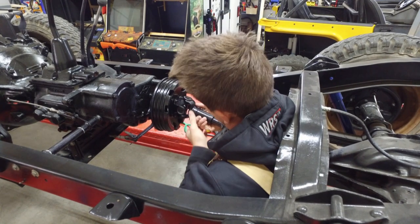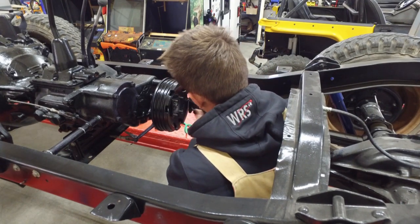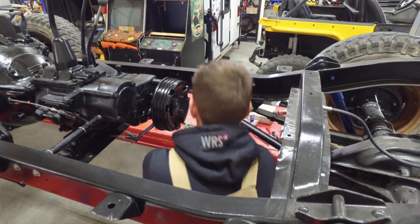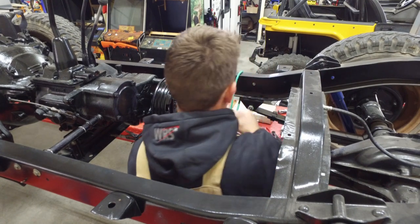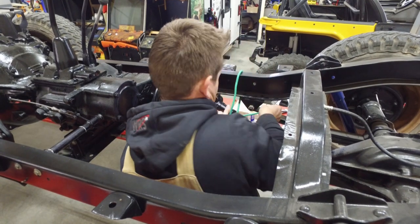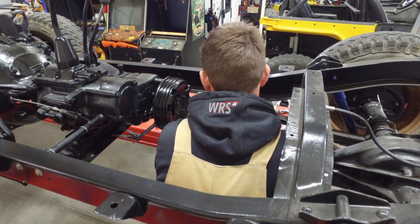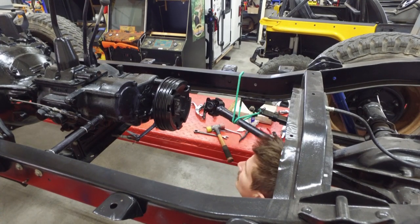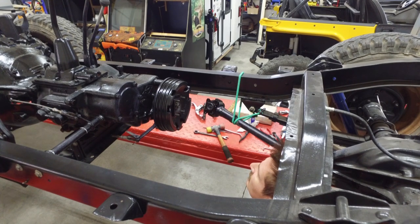And then get ready, when you squeeze this back, a bunch of grease is gonna shoot out. And then what you can do, push it off over to the side, get yourself a bungee cord. Pull that out of the way. And then we're gonna start doing the yoke, the nut, pull that out.